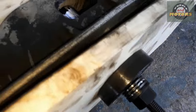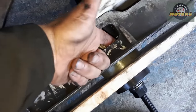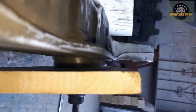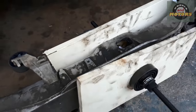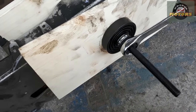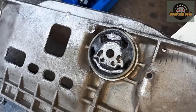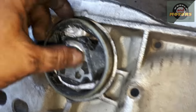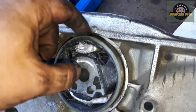Using a 27mm nut, make sure the window in the bush matches this window and it all sits straight from all sides - nice and straight. Then we slowly start turning the 27mm nut. I'm taking it really carefully. This is where we are now - it's gone halfway in and the narrow bit with the window seems to be in.